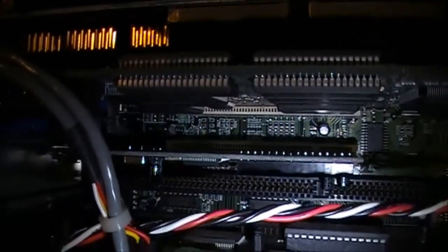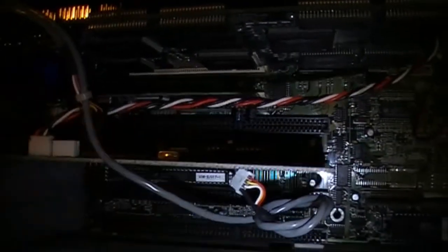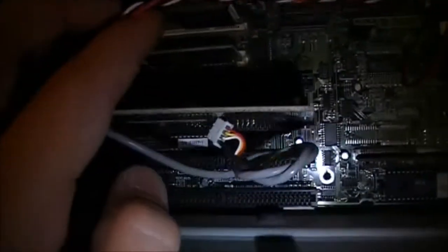There is a network card, quite a recent one, I should say. It's a 10/100, I think, this one. Under here there is the S3 audio card using an ESS AudioDrive chipset, and it's a fairly low-end card. This is the only card which is still original to the machine. It has never been replaced. As for expansion, there are only 3 ISA slots available now. All the PCI slots are in use, and there is no AGP, of course. And here you can see the AT power supply connector.